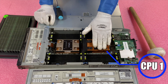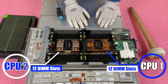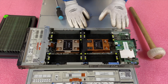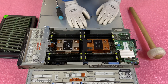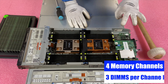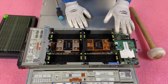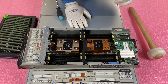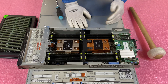CPU 1 controls the 12 DIMM slots on this side; CPU 2 controls the 12 DIMM slots on the other side. Everything is color coded and labeled by Dell, which makes it very easy and convenient. There are six DIMMs on each side of your CPU, and that breaks down to four memory channels, with three DIMMs per channel. This is important to note because this is how you're going to install them. If you're maxing out, it's not as critical which order you go in, since ultimately all 24 DIMM slots will be filled. But when you're not maxing out, this is very key.